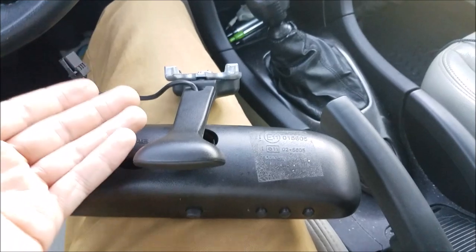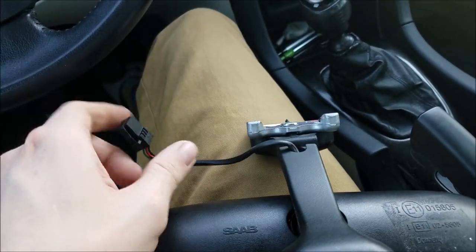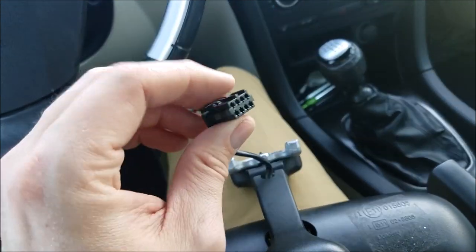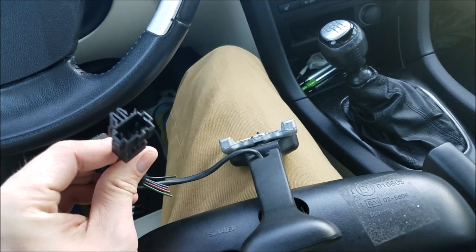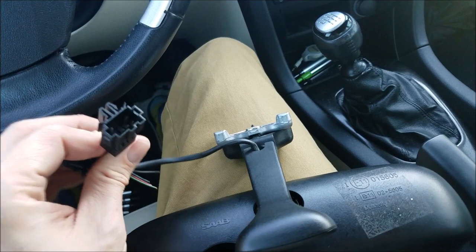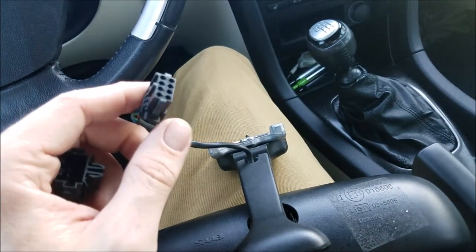The first thing you want to do is purchase a rear view mirror. It can be from either a Saab 9.3 or a 9.5. Now the auto dim with the compass and homelink - they did switch the connector depending on the year. From what I can tell, the older ones had a female connector. I'd say 2002-03 to 2006 is more than likely going to be the female style, and then 2007 and onward should be the male one.